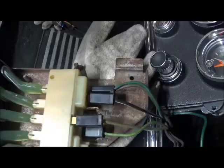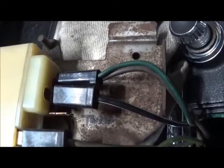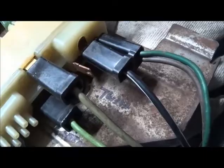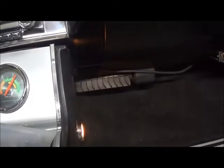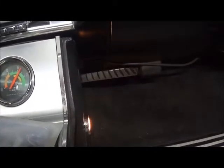Assembly time. After quite a bit of research, we determined that the twin wire — which had been connected here — needed to be switched over to terminal 3 in order to get all of the fan speeds in all positions. And now that works just fine. Checking the system: that is on full heat, push off — that should retract up, and it does.